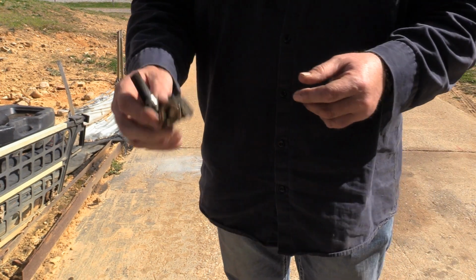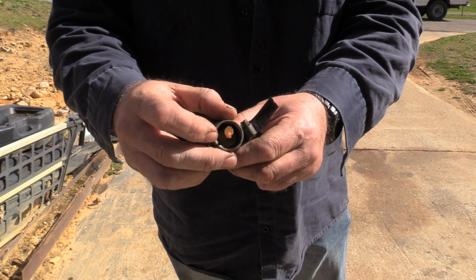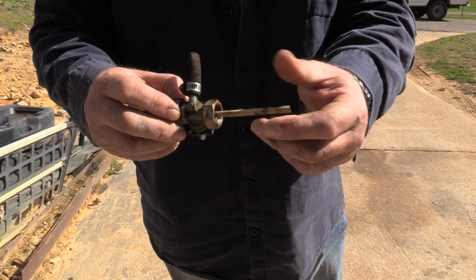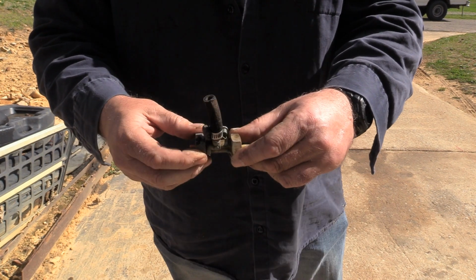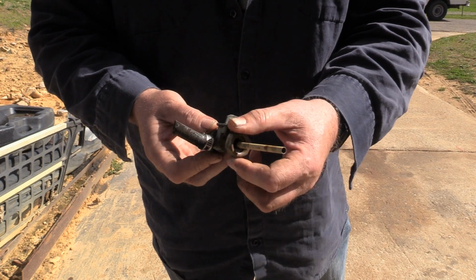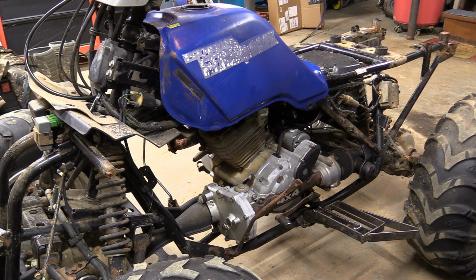And then after a little cleaner, you can see that that filter's still in good shape. So is the O-ring, and all that junk's gone out of the inside. Everything's nice and clean again. So we'll reassemble it with a 24 millimeter wrench. And all right, so